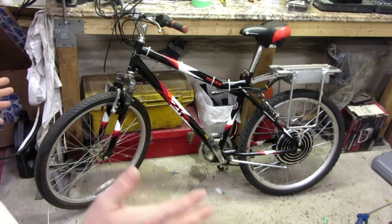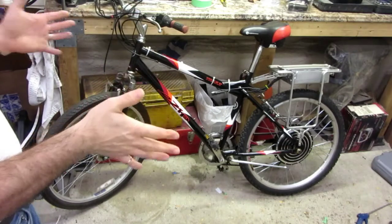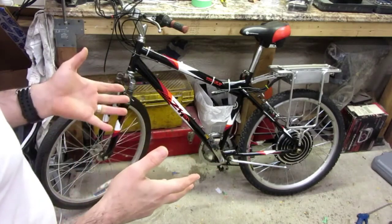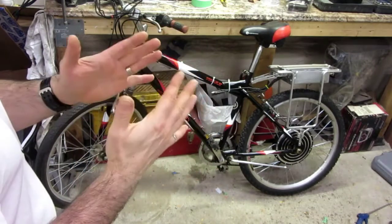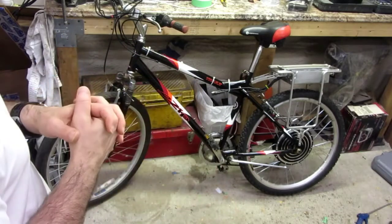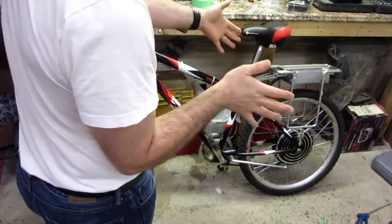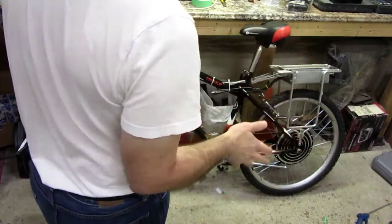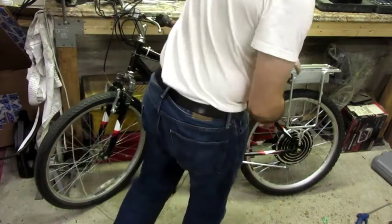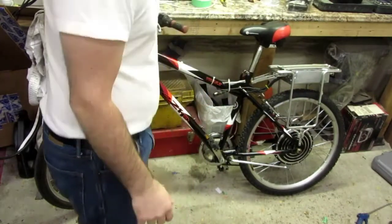Anyways, that matches. I also took the rim and took out the dish, so I centered the rim again, because I think the spokes were uneven. The spokes are evenly sized, so if you try to dish it, then one side's going to be looser than the other. So I tightened them both up. They're both equally tight now, and I trued the wheel, so everything's fine, and I just put an extra spacer on one side to shift the tire over. The rear brakes are good, front brakes are good. All the wiring, I just zip tied it all temporarily, stuffed everything inside the controller box, everything's okay. And now we're just waiting for the battery, which came in today.